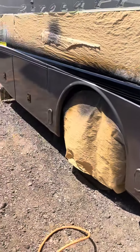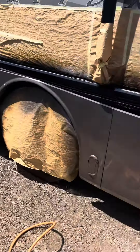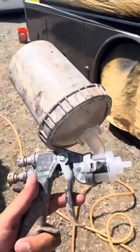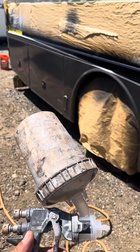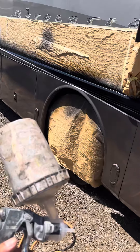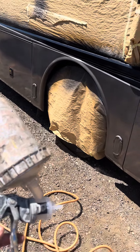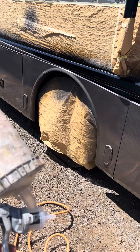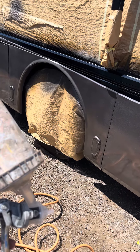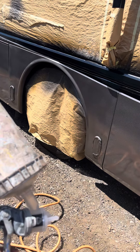So many people are interested in my video about how to spray outside — how do you leave it so clean, how come you don't get dust on the vehicle? I told them there are a couple other things I have to mention, so I'll go over it again. First of all, my pressure is set at 20 PSI. I do go a little higher sometimes. The clear coat is mixed 50% reduced.